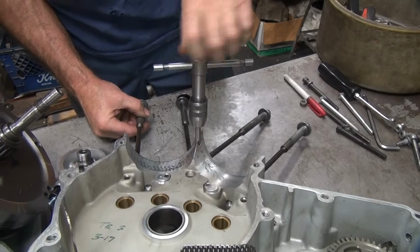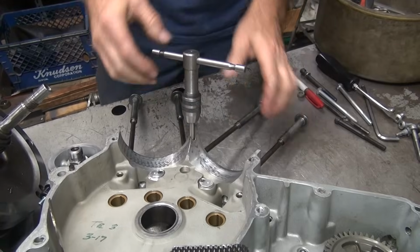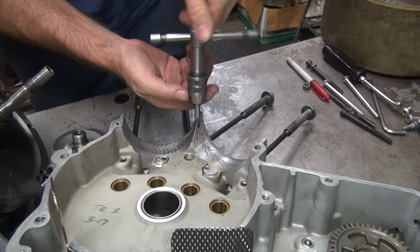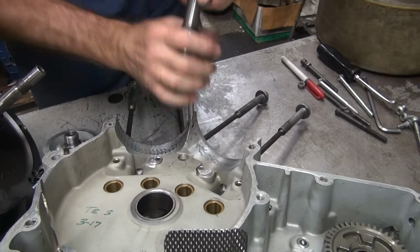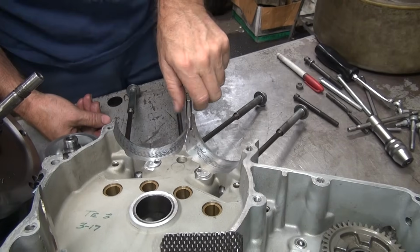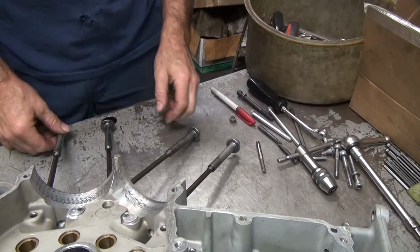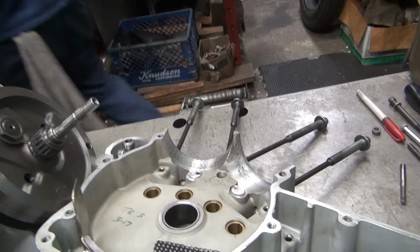There's about 3/8 of an inch. You got about 3/8 of an inch there, Fred. That's not very good. Not by Tatro standards. That means you better not torque that bolt very far. Of course, you can't torque it very far anyway because of the way the threads are. There's nothing left because that happens. I'm still trying to figure out how you're going to do that. Did you do a bottoming tap? These are tapered and bottoming.